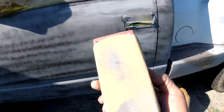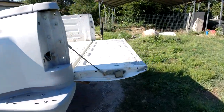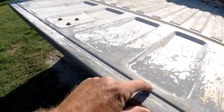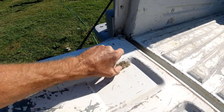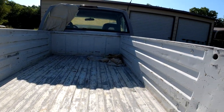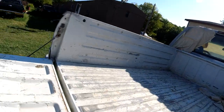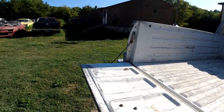You've got to keep pounding the sandpaper there with your hand - you can't do it holding the camera. Let me do that door there and then we're going to get the DA and sand it down. Probably just get the rough edges off - there's a little bit of dried concrete or something there, chip that off and basically just scuff it down so the paint sticks. We'll concentrate mainly on getting these edges smooth, and the top of the tailgate smooth, and the rest of it basically just scuff it.